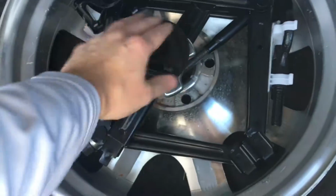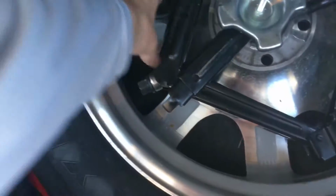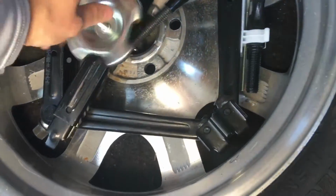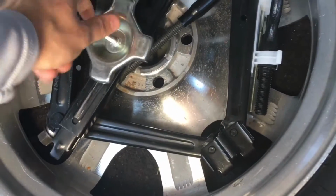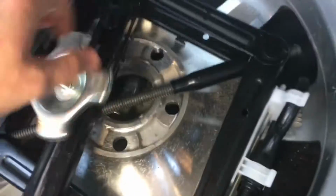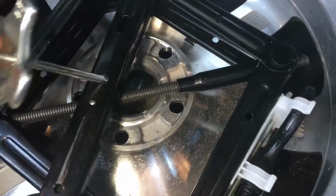And that should suffice. Now on the 2016 Explorer, you got these little clips back here. You got to turn those, pop that off, toss that up there, and then you can reveal your spare tire, just like so. Take that off, toss that over to the side, and you got to spin this guy. I think you can unspin him just enough to where you can get the hook at the bottom to come out, like that. Set him aside.